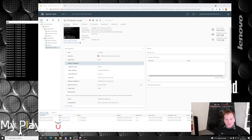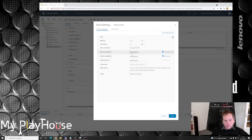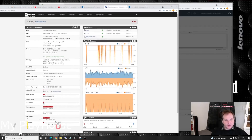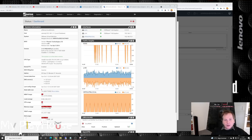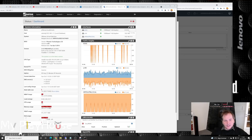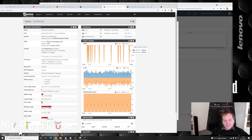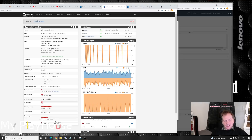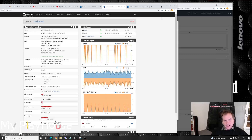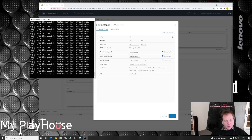I'll have a look and figure out why this isn't working. I think I forgot to give it some more RAM. Checking the network port — it looks okay. Looking at PFSense now: the WAN interface is connected to the VLAN but it's not getting an IP address. It looks like it's trying — it's sending DHCP discover requests — but not receiving anything back. Our pings are not getting through and my router is reporting unreachable.